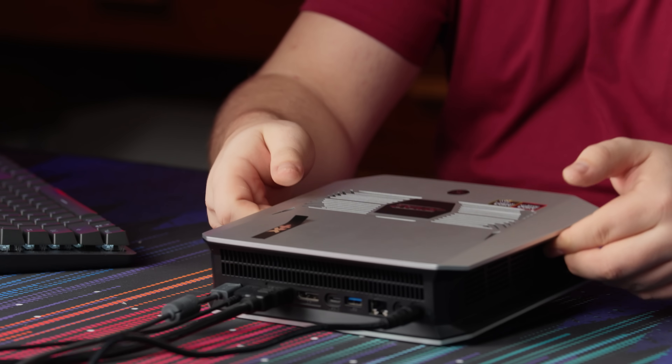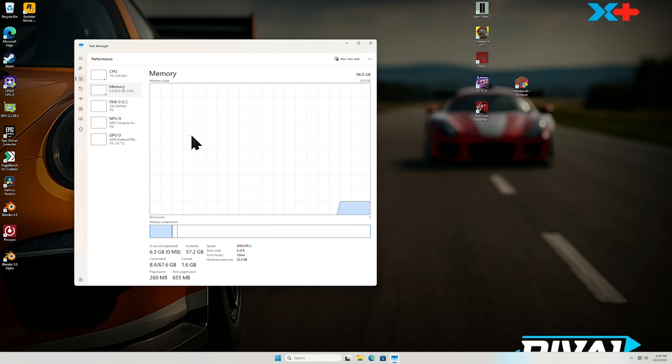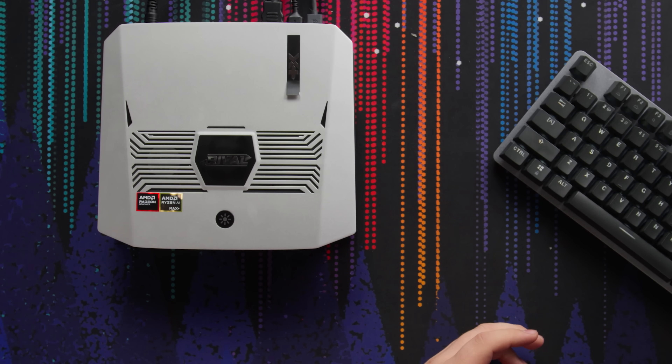Let's open up task manager. 32 gigs of RAM is being allocated to the GPU and 64 gigs dedicated to the CPU. Just like the Framework, this can be configured in the BIOS — you can go from half a gig all the way up to 48 gigs of VRAM. That's not quite the three-quarters the Framework allowed, but if you put 48 gigs on this GPU, you have more VRAM than a 5090. So running large language models that fit entirely in RAM will theoretically be much better on this device than some higher-end cards.